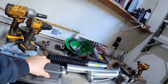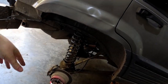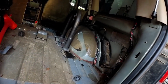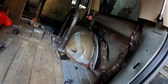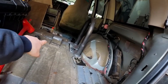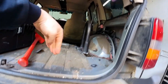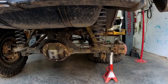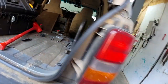I bought these 5165s to alleviate that because of the long shaft, figuring that was going to handle the travel. But then the problem became how to get them to fit — they're not going to fit in the standard location. I had to cut some holes in here. Originally I wanted to run a tube across and have the shocks go there, but it would have ended up right in line with the brake clip, so that wasn't going to work.